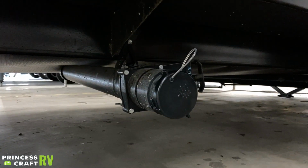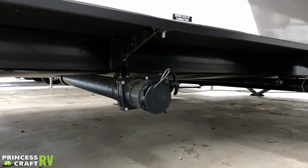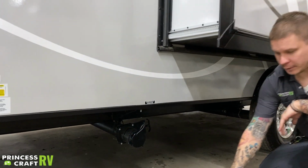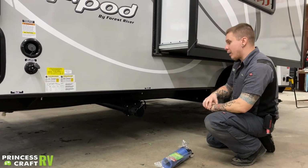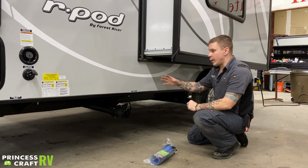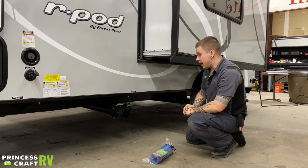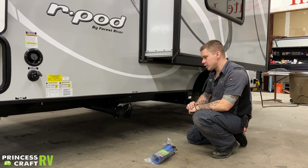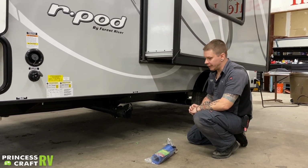Now your black water valve, excuse me, needs to be in the closed position anytime you are using the unit, no matter if you are hooked up to full-time septic or not. We want to keep the contents of that black water tank in as wet or flowing a condition as we can. That way it will evacuate the tank and easily flow down the drain. So keep that valve in the closed position, use the monitor panel on the inside, and only dump as necessary.